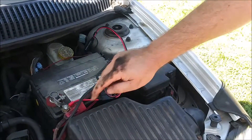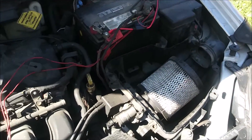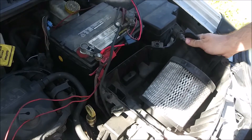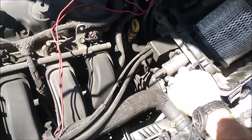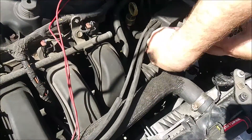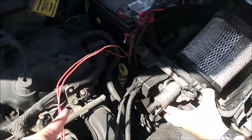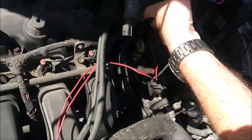We had to loosen these screws on the outside so we can lift the air box cover off. Now this will get out of the way — then lift this out of the way. I've already loosened this boot so I should be able to pull that loose from there. Disconnect this hose, and now this can just go out of the way.